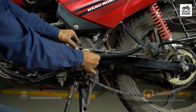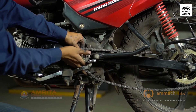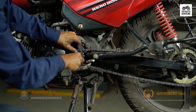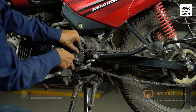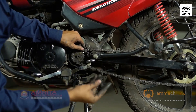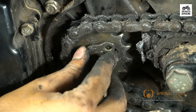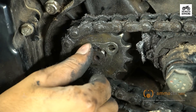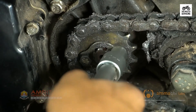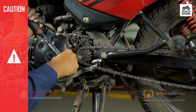Slide the chain forward with pliers and put the properly oriented front sprocket onto the chain. Align the sprocket and chain into place and slide it onto the transmission shaft. Install the front sprocket retaining plate and screws tightly. Note: these are small screws and the threads can strip if over-tightened.